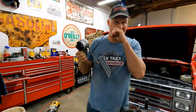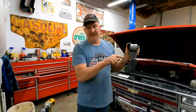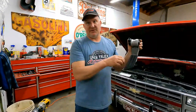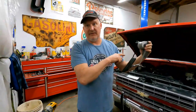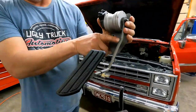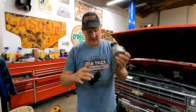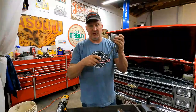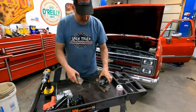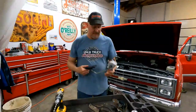The OBS diesel pedals are something we've had a lot of comments about, and we'd said we'd never tried one — and this is a good reason why. When I measured from the brake pedal over to the accelerator pedal, it was four and a half inches. An original pedal is two inches — so this is two and a half inches farther over. Also, his biggest complaint was that when you push on this pedal, it takes zero effort and there's a ton of travel. We're going to fix that.